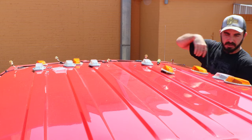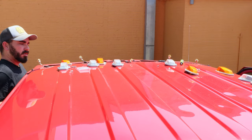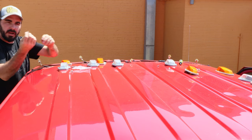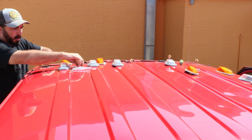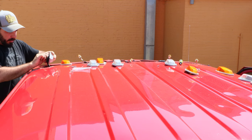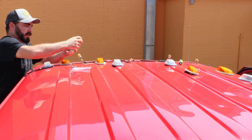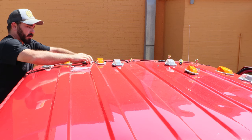Here's a comparison shot — you can see the curve on both that fits the roof. Got the cab lights out and all the bulbs out. Now I'll show you why we pulled all the bulbs out first. We're going to pull the park lights on just enough to light up the cab lights. Get the LED bulbs out — these are a direct replacement, you just plug them into the socket. Always turn the lights on and plug them in before you mount your cab lights, because if you don't, you might not have one seated all the way or you might have a harness issue, and you need to address that before mounting.